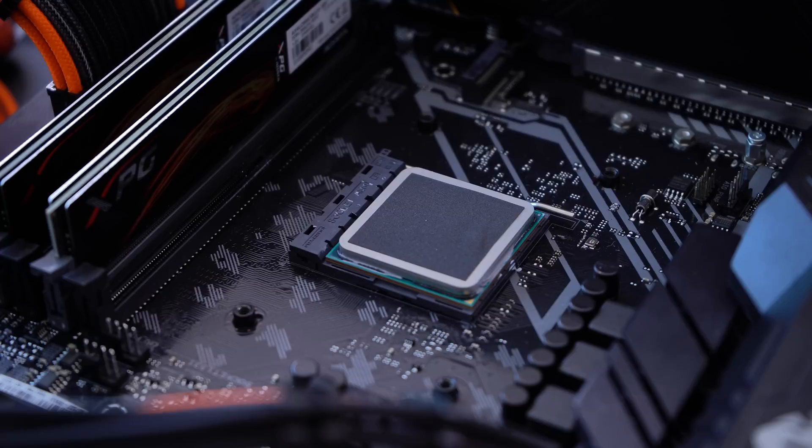There is one catch: the Carbonaut pads. I didn't know this going in — I thought the pad would be bigger and we'd cut it to size, but Thermal Grizzly sells different size pads. I had a 32×32mm pad, basically the size of an Intel desktop IHS. The recommended size for Ryzen CPUs is 38×38mm, sold as a separate SKU. All I had were Intel samples, so the corners of the Ryzen heat spreader weren't covered — a slight disadvantage of maybe one or two degrees.